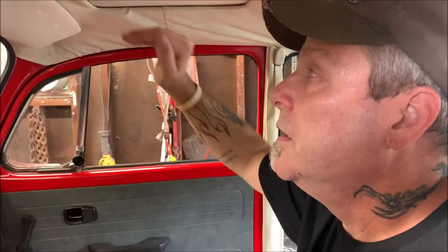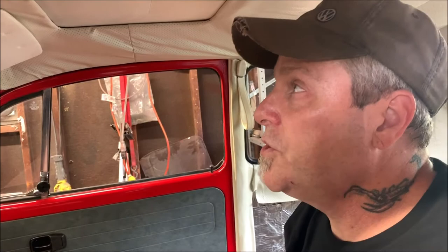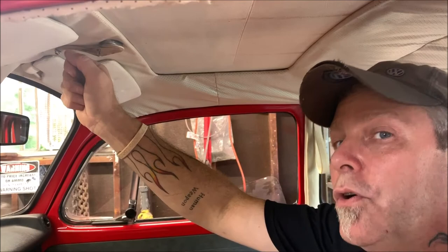You'll go ahead and get the roof all leveled up on both sides. The adjusters front and back are self-explanatory. Okay, once you have done that, to check your roof, go up top, look, make sure it's done. Before you tighten these two screws back up, you're going to take the crank handle and go counterclockwise a half turn. One half turn, that's it.